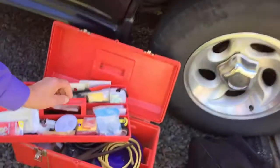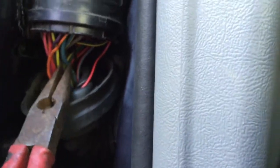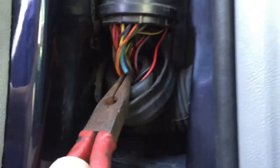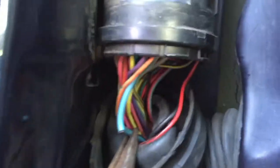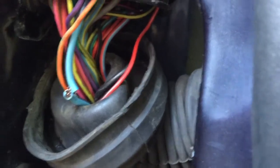You basically need butt connectors and any of these tools from the electrical box. There's that wire we were looking at right there. We're just going to grab a hold of it, pull, reach in there, grab this blue wire. And you can see that it's broken — it was just barely hanging on by a thread. So basically you replace it — we're just going to use butt connectors, extend it a little bit, probably run it back into the cab, or we can just repair a short section right there with some butt connectors.